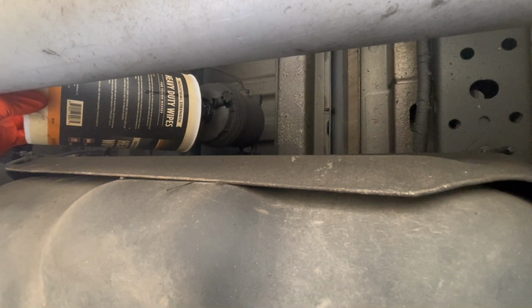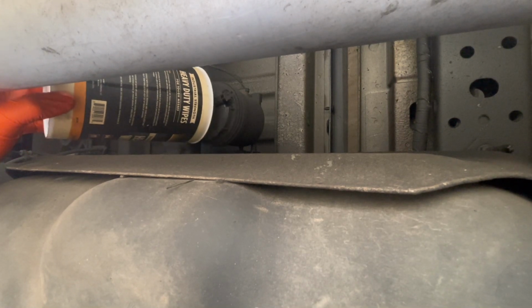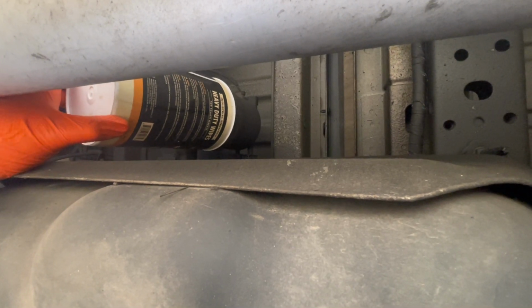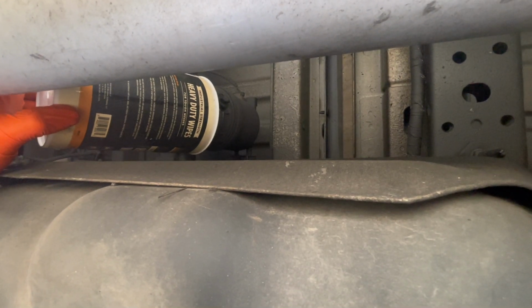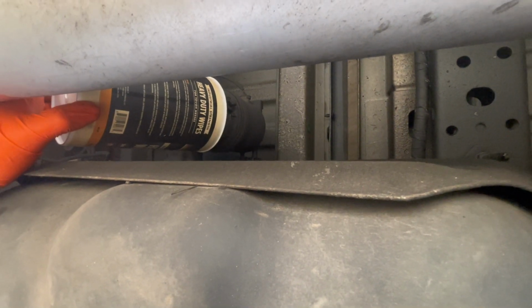Has a little petcock on it. I had this little hand wipe container that I stuck up there. It has a spot you could put a little hose, maybe a 3/8 hose on it. But I figured I had this container and it caught the fuel pretty well. So I'll pull the container out, shut that petcock, and I'll show you how to get this filter out.